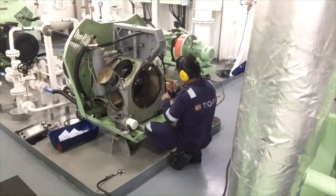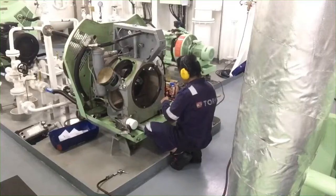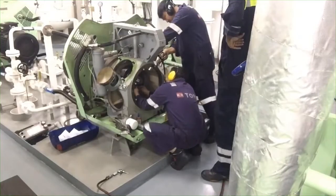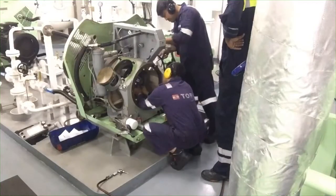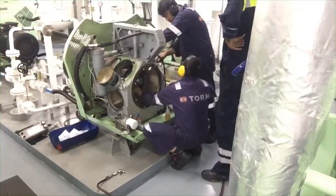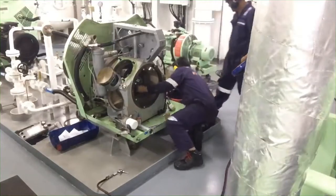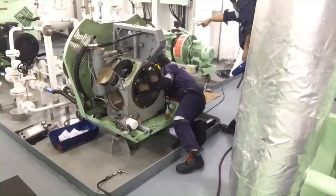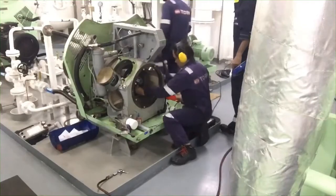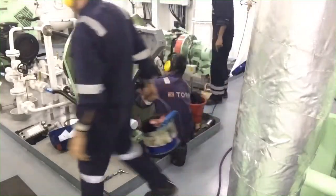That is why this kind of compressor is very hard to maintain, because if you change something like that crankshaft metal plate, you must disconnect or take out all the internal parts. It's not the same in Tanabe. If you change the bearing on the connecting rod, they have a half shell type, so they have two bolts downstairs. You loosen these two, put in the shell bearing, then box up. Here in SPERRE it is different.